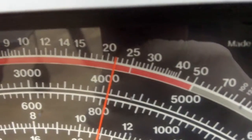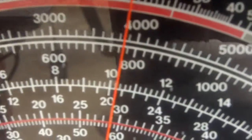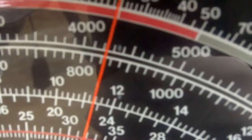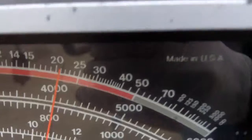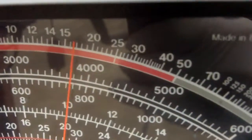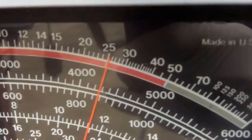While I do this up here, watch down here at our idle to see where we get our best idle speed. Now we're going to back it out — picking up idle. We don't want to go too far out, so we're going to leave it right about there. Same thing over here for this carburetor. Once again you can hear the idle degrading, then we back it out. See the idle degrading? Now we're going to come back out, get our best idle. Not going too far — see, we picked up some RPM there.